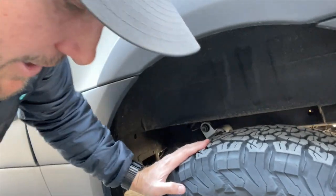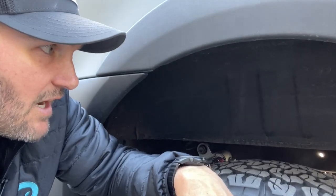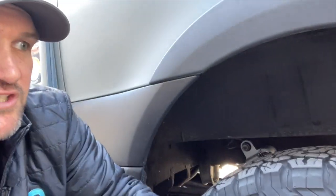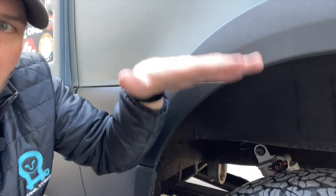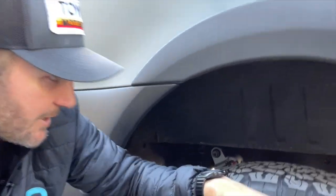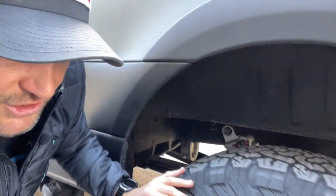The shock is not contributing to the spring rate of the vehicle. What the shock is doing is counteracting the spring in some sense. If the spring is springy and you go over a bump, it would spring up and then bounce. On a washboard road, the wheel would actually come off contact with the ground fairly frequently — that's a very bad thing.